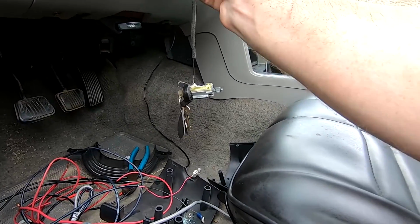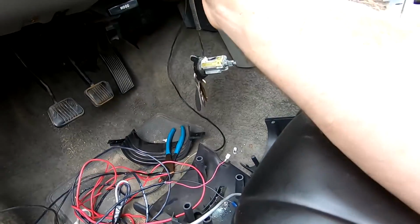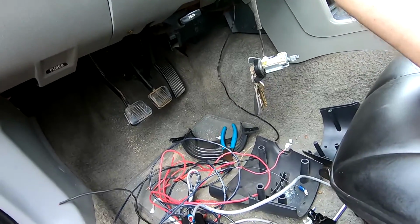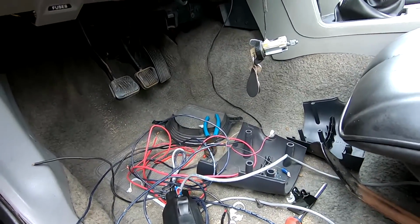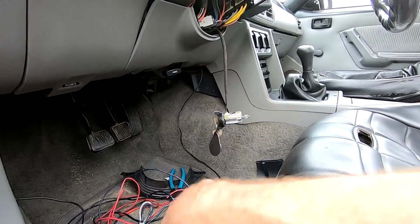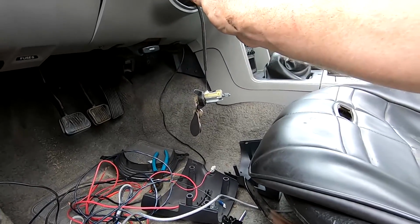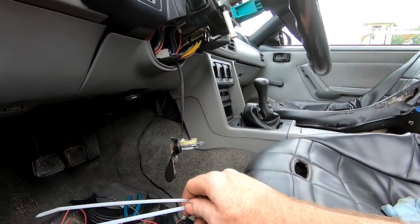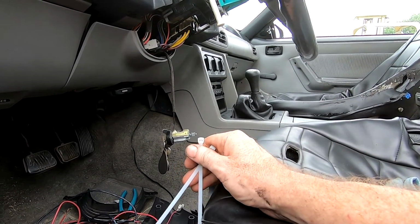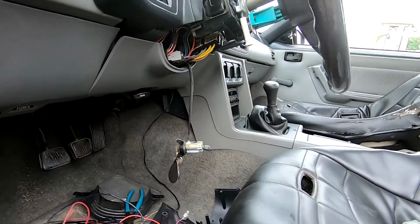I think there might have been a recall on these way back in the day. But regardless, for now, one way to fix this, guys, believe it or not, because it does sit in place, but it will knock itself loose again. That's the problem. I'm just going to go ahead and tie wrap it on. I'm going to put a tie wrap in the front, tie wrap in the back. That'll hold this main connector on, and that'll actually make sure the car can run and move around. And believe it or not, this is a pretty sturdy fix.